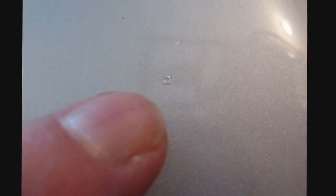So let me try and get that one. I'm going to go off camera so I can aim this really well. Now what happens is you actually end up putting too much paint on there, and it comes up above the surface of the rest of the paint. But you can polish that down. Certainly the darkness of the chip is gone now, but it's got a little too much paint on it — I think we can fix that.